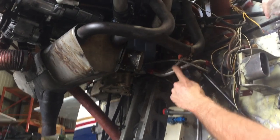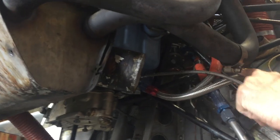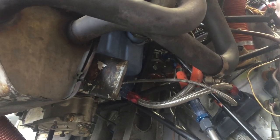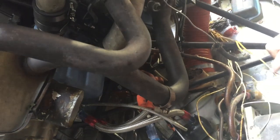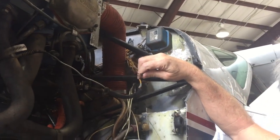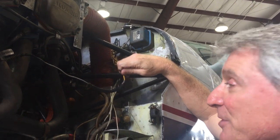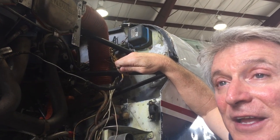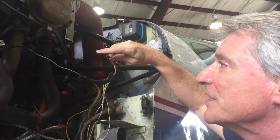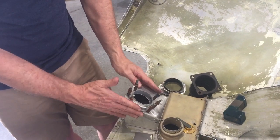While we were here we replaced the fuel lines too — they're all new and shiny. We also found a broken wire from one of the cylinder probes for the exhaust gas temperature. It's an old analog setup, and I've been debating whether to put a full engine monitor in. That broken wire will be replaced as well.